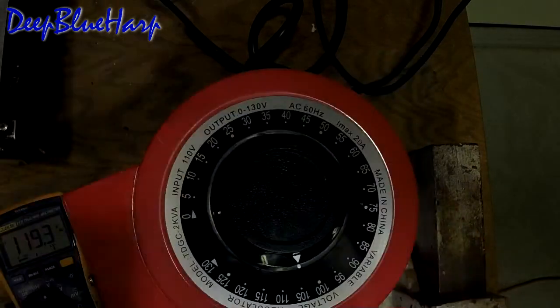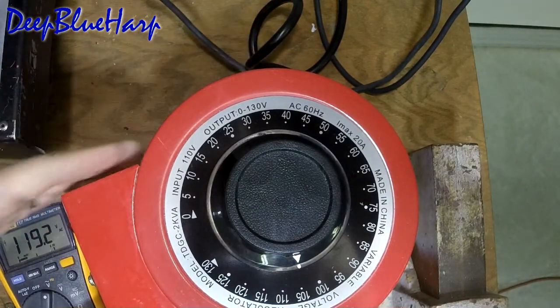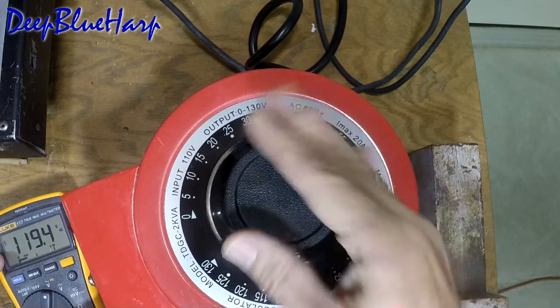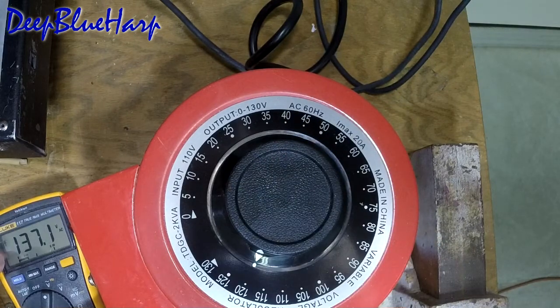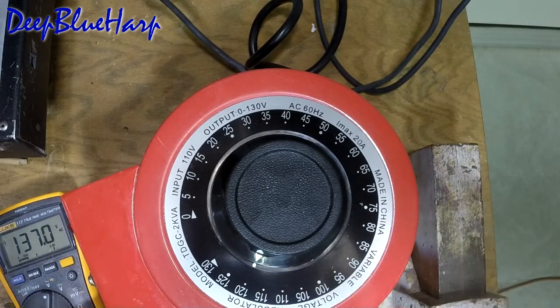If you're depending on their manual, forget about it. It's built okay — the front end of the can is kind of whompy, but aesthetics don't really bother me as long as it works. The big takeaway here is: before putting it into use, get a proven voltmeter, go through the dial, and mark off 120 volts — or 110 if that's where you're testing. Mark it, calibrate it, then put it into use. If I go past 120 on the dial, watch what happens — I'm getting nearly 140 volts. I don't want to power up any 120-volt equipment with 140 volts. Also, this is not a line isolation transformer — it's just straight line in, electricity out. Thanks for watching.